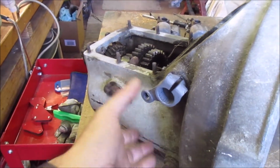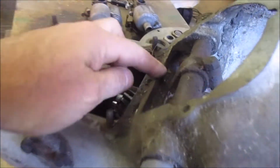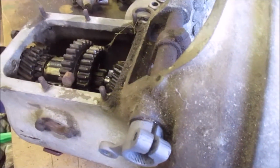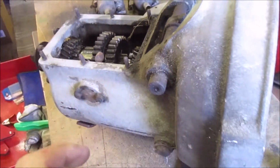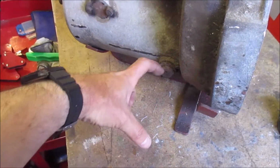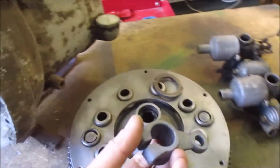And then when you operate the clutch pedal, there's an arm, and I think this piece rotates here at the top, which is what pushes all this back. So I'm gonna degrease all this, put some mouse milk on it so it all comes ungummed, and then I think that's the way my one is going to work. So on mine, the shaft is much longer, and the clutch and the brake pedal actually sit right on this shaft. So I think that'll work. At this stage, it's just a matter of trying to make what I have work.